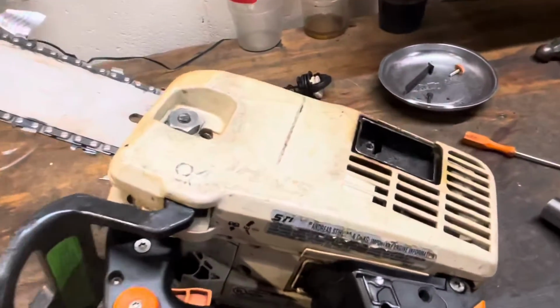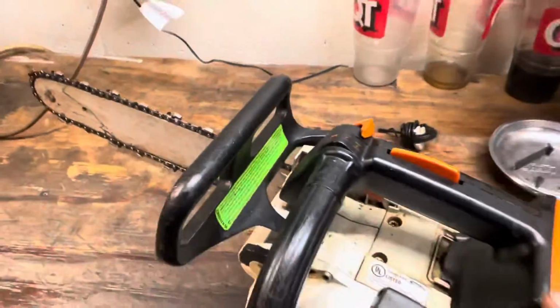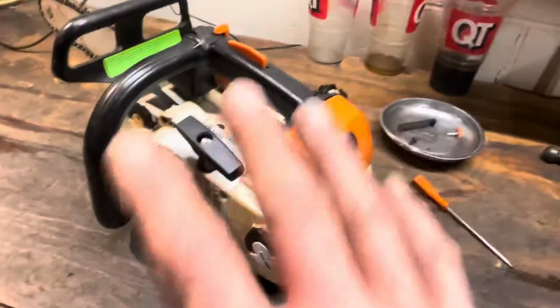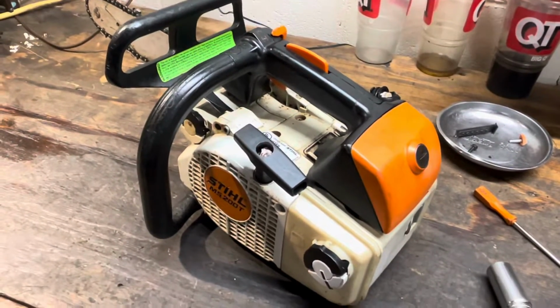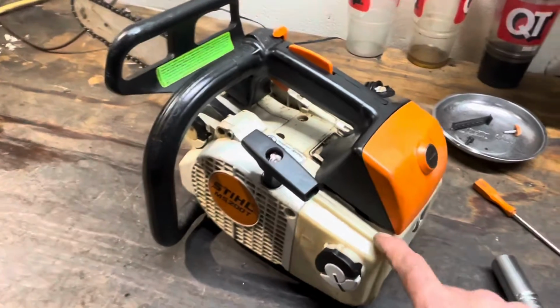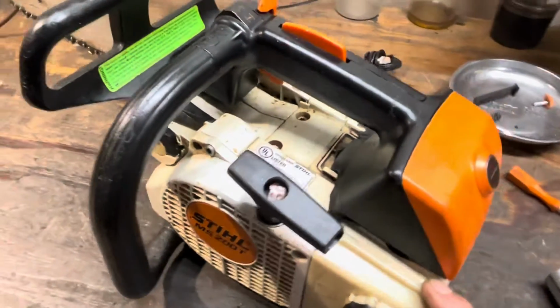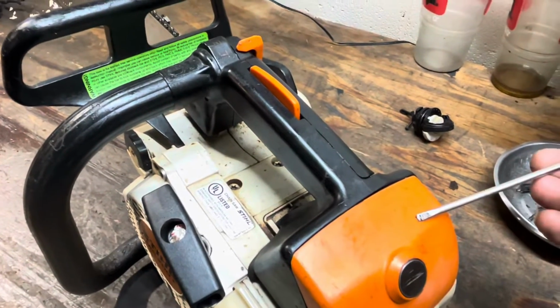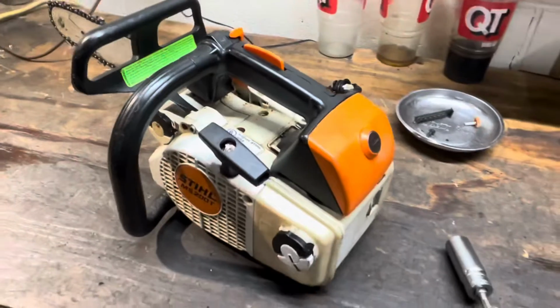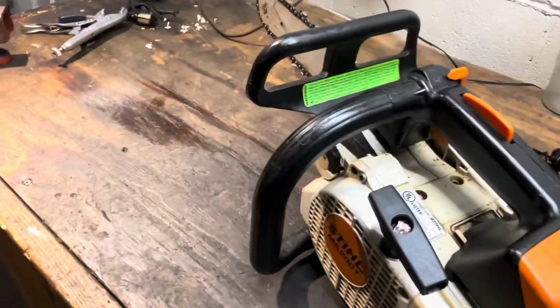So anyway, I left the spark arrestor out, did a small timing advance. Let's take this outside. Now, I have not even pulled the cord on this. I have no idea, but we'll just do it live. Typically, this should be 5 pulls from a dry carburetor, and it should pop. I've preset the carburetor where I feel like it should be, and we'll maybe have to do a little bit of slight tuning. So here, let's take this rascal outside and put it to work.